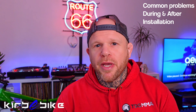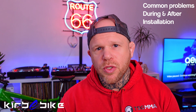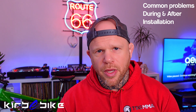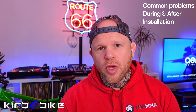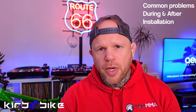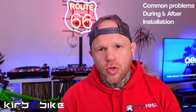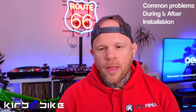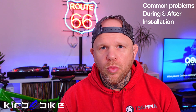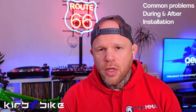Number two is people expecting everything to just work with no effort. DIY e-bike kits are exactly that — DIY. They're not made specifically to fit every single bike perfectly. Some batteries are going to be tighter, some wheels are going to be a bit more fiddly. Expect to have some issues with every kit you fit. You're going to need to check your spacing with your spacers on your back wheel — fit too many and it won't fit, too few and you'll have wires rubbing. You really have to fettle with things, and that is completely normal.